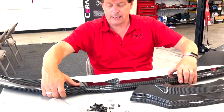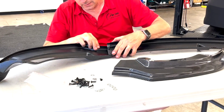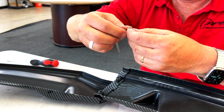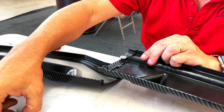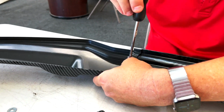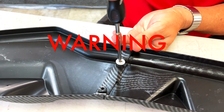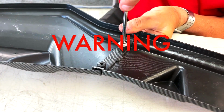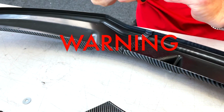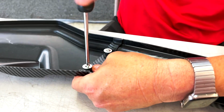The first thing we want to do is connect the front right to the centerpiece. On a very nice table, so you don't scratch it up, just put it right on top like this. Start with 1 stainless steel screw and 1 of the washers. Put it in here, and then put it right through into the connecting part for the front right and tighten it down. Be sure you don't use the black one here. The black screws are too long, too deep, and they will penetrate and come out the other side, and you're going to see it. So put your hand underneath and feel it. Make sure you're using the 4 stainless steel screws for the connection step. And that's what we're doing. We're not installing it on the Model Y yet, obviously.